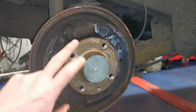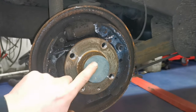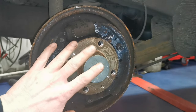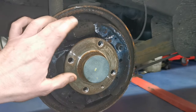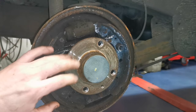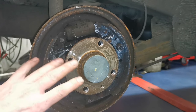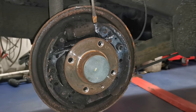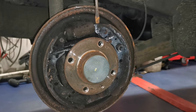I prefer not to touch this hub - there's a big bolt in here, it's a stretch bolt and it's really really tight, so just don't touch that. You can do it without touching that but you have to take the wheel cylinder off - there's no real other way. That's no big deal since I'm going to change them anyway. First thing I'm going to do - and this may seem a wee bit counterintuitive - is I am going to drive this adjusting wedge back down again and actually splay the shoes out again.